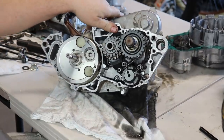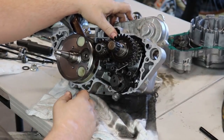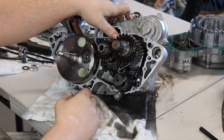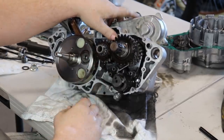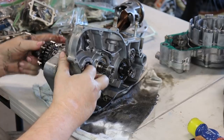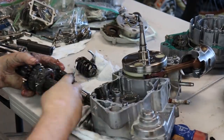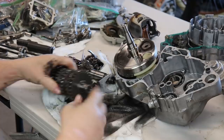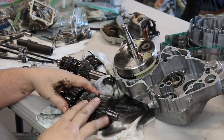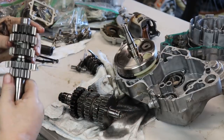These transmissions don't come out individually — you have to pull the whole thing out as one piece, and it goes back in as one piece, which is kind of a pain. Yamaha rivets their shift forks in on the shaft, so it's not an up-and-down; the whole shaft moves up and down, making it a little harder to get apart and put back together. When you get the transmission out, make sure everything is there. On these ones they don't have end washers, so you're in good shape there. Normally we would inspect these gears really well, but since we're replacing them, and they do actually look fairly good.